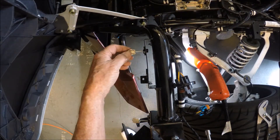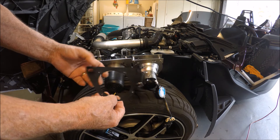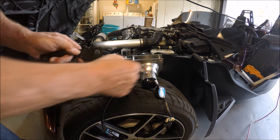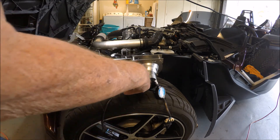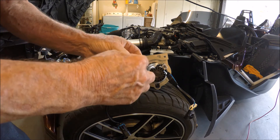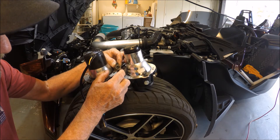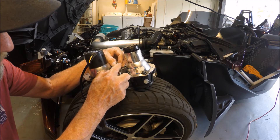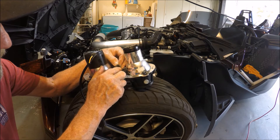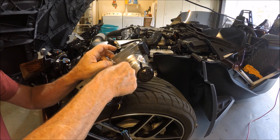This is the original bracket for the original headlight, and there's a rubber mount we need to take loose and move to the new bracket. Once you get it out, you can simply pull the rubber grommet off the washer — it's a special washer for the headlight. Squeeze it like that, get one edge hooked over, and with your finger squeezing it, it will just go right in until it's finally seated on both sides. Put this in from the top.